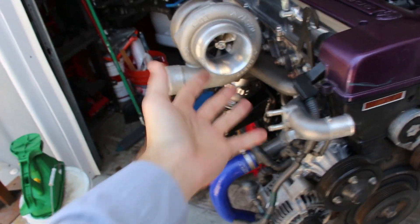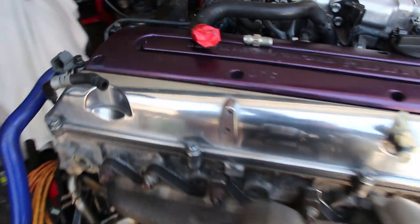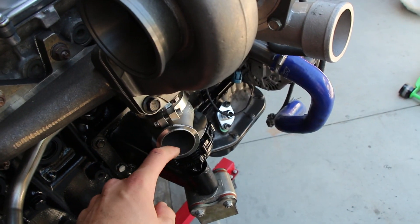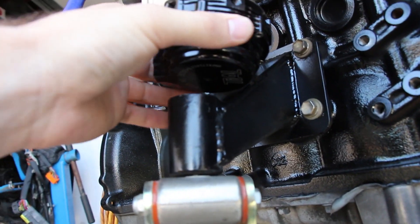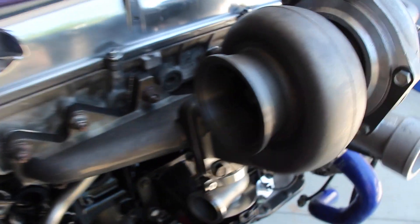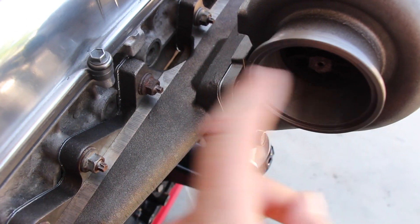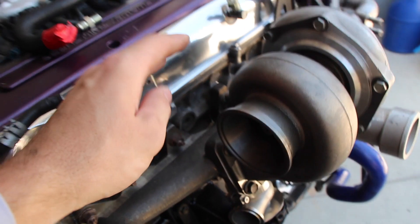The single turbo is on — everything is bolted up and torqued. The manifold is torqued, the turbo is torqued to the manifold, gaskets are in. My wastegate is on and it barely clears the motor mount — I've got about an eighth of an inch to spare. Still figuring out which way to clock it. The screamer pipe is in the mail and running late, so I'll leave it loose for now and run the screamer pipe right between the downpipe and manifold.